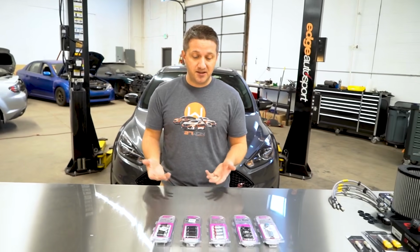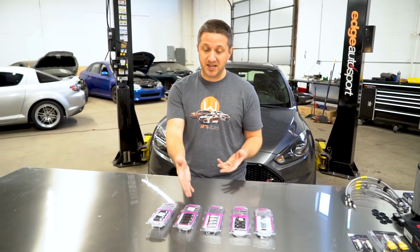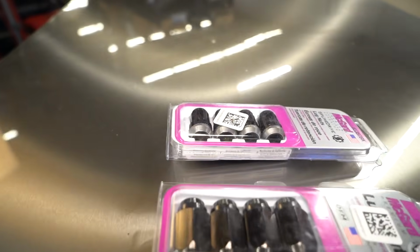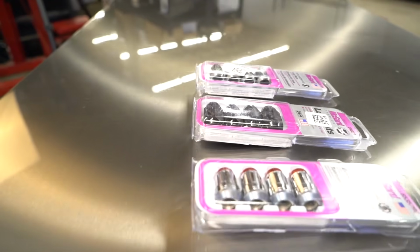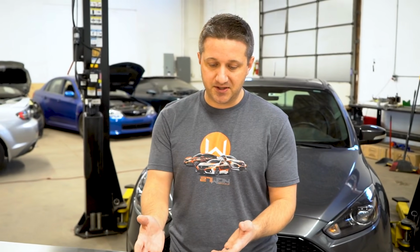All right, next up is lug nuts. These are a super simple, easy install. Obviously, you're just taking one set of lug nuts off and putting another on. As long as the wheel style fits the taper on the lug nut, this will fit dang near any wheel. There's some kind of funky combinations out there. Hondas have a little bit different stuff, but for the Ford, mostly anything will work, even with a stock wheel. All aftermarket wheels are going to be similar to this design, or make use of this kind of tapered design here.